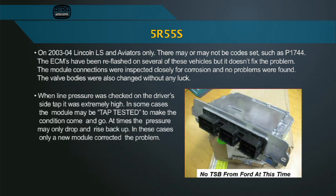And these are vehicles where some have actually been reflashed to try to fix this problem. What we were finding was very harsh shifts, harsh engagements. Sometimes the shifts would be erratic — shifting one, two, back to second, back to third, back to second — with no rhyme or reason to any of it.